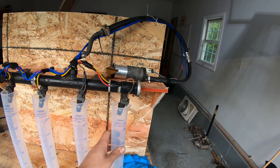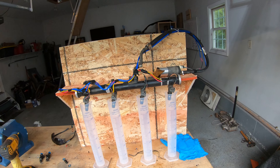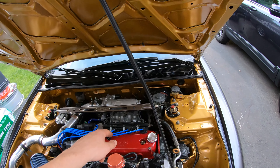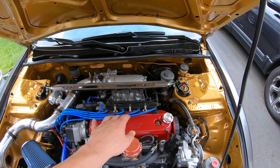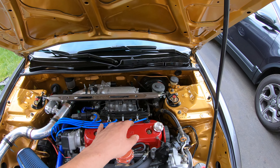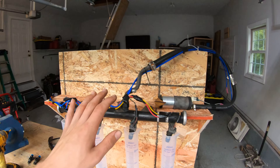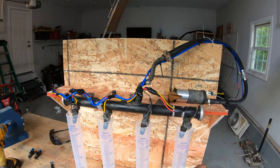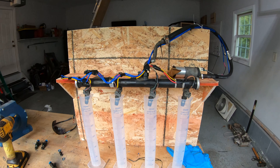I'll flow them all at the same time to make sure everything flows the same amount — confirming fully balanced injectors so we don't have one hole running lean and potentially melting a piston. This is important when you run higher horsepower. I have four decapped LS truck injectors in the Honda with a modified fuel rail — they're a solid probably 800 CC injector, but I never flow tested them or checked if they were leaking. I could have an injector that constantly leaks and not even know it. I can pressurize the rail with injectors off to see if any are leaking.